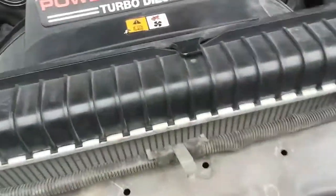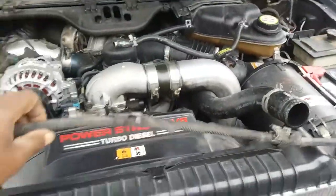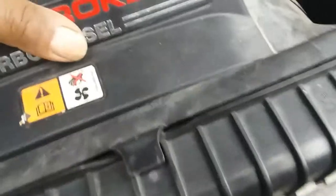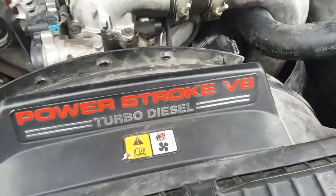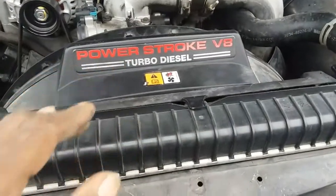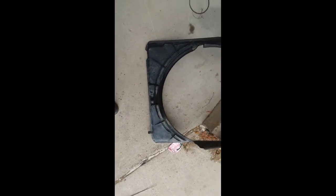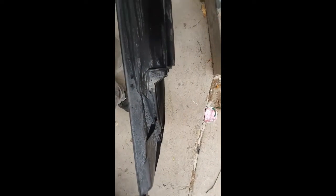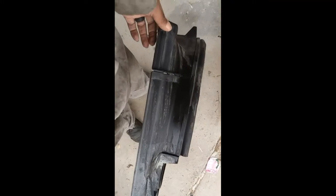The reason for taking these off is so I could flip the shroud back out of the way, then pull the radiator a little bit more forward and pull this out. I pulled the fan shroud out — I was a little worried about getting that out of there, but it came off pretty fine. One piece. I thought I had to take it apart looking at it, but the bottom is cut thinner than the top, so it actually came out pretty easy.